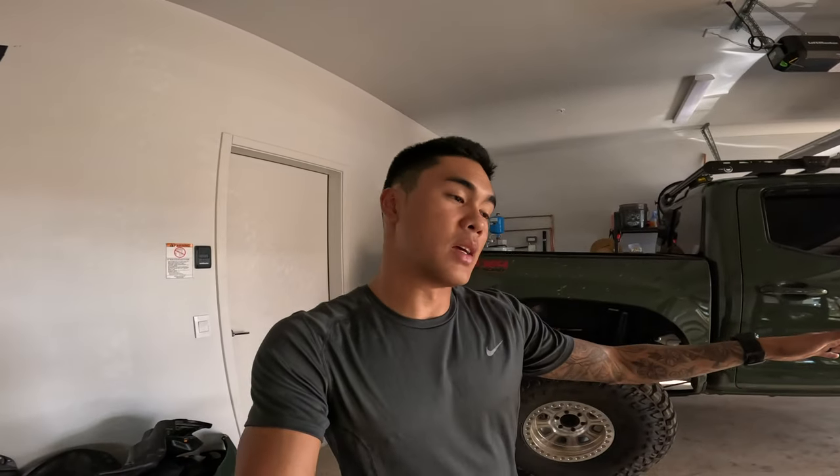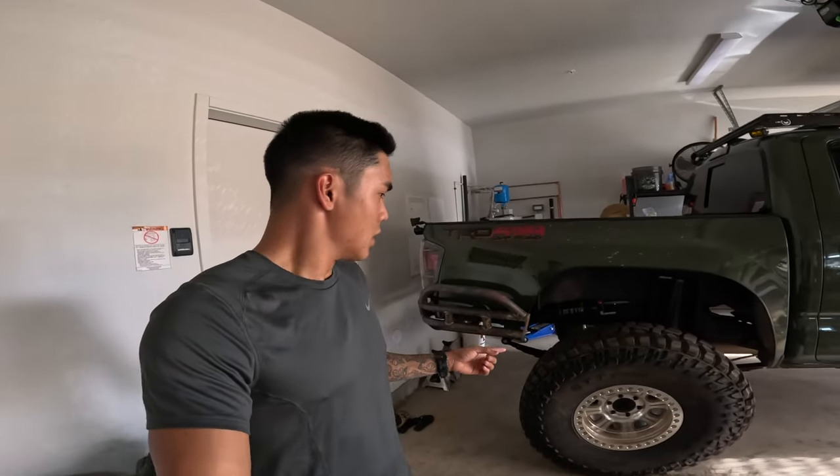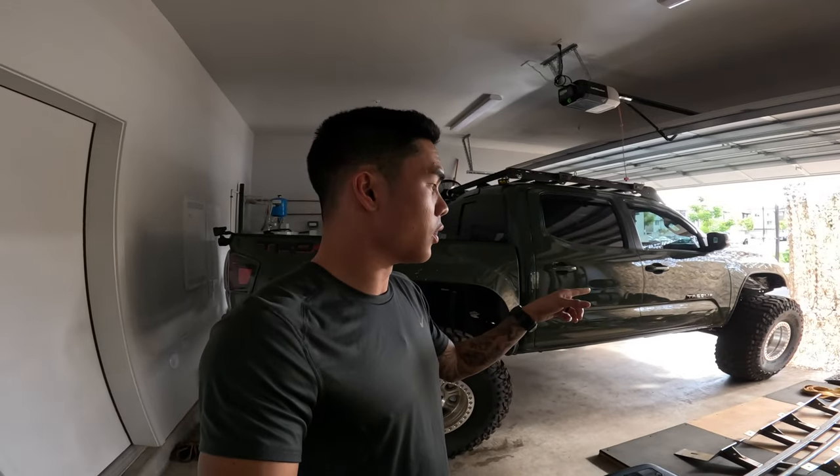We do still have to do a lot of fine tuning. I'm going to mess around with the leaf pack in the rear, do some flex testing, see where we need to clearance more. I also still need to do my cab mount relocation and I might be cutting back some of my firewall to get maximum up travel, because I am rubbing right now on the cab mount, which I'm not surprised. Currently it's on about three and a half inches of lift in the rear and the front is set to the lowest setting — I'll show you guys what that looks like.